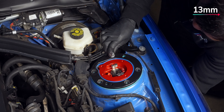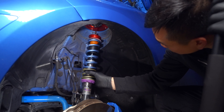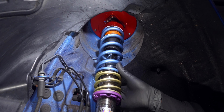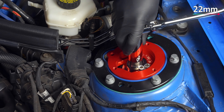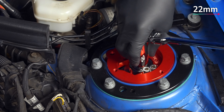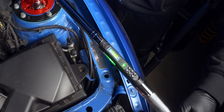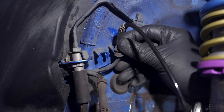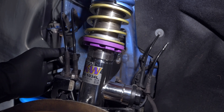Here I went with the OEM bolts, but depending on how much camber you want, you may need the Vorschlag bolts as they are shorter and will not interfere with the perch as it slides more inward. When you jack up the assembly, you should hear it lock into place before threading on the top nut. The top nut should thread down enough that by the time the strut starts to spin, the counter hold will poke out far enough for a 9mm and pass-through socket. Set your torque wrench to loosen at 40 newton meters. The 13mm bolts get 28 newton meters in the star pattern, as do the set screws. Going back down, reattach the wires and end link — if you have the SPLs, those are set to 25 foot pounds.